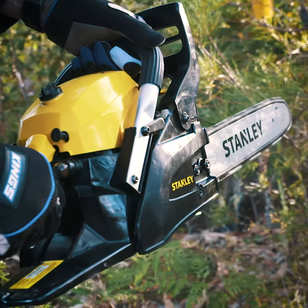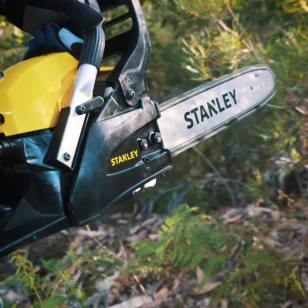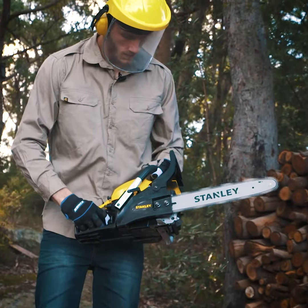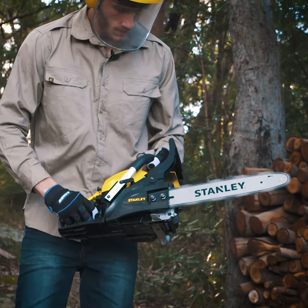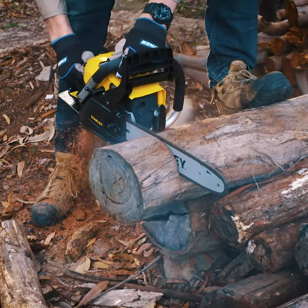Before using the chainsaw, you need to let the chainsaw run for a good 5 minutes while revving the engine every so often to get the chain warmed up so you can adjust the tension for the last time. While it's warming up, check that your chain is being properly lubricated. The bar oil reservoir is designed to automatically feed oil onto your chain while in operation.